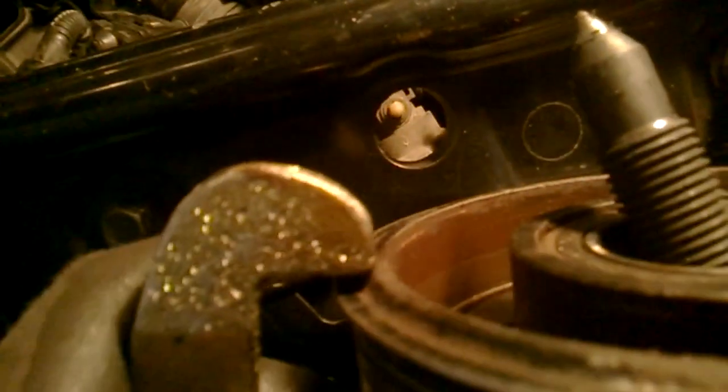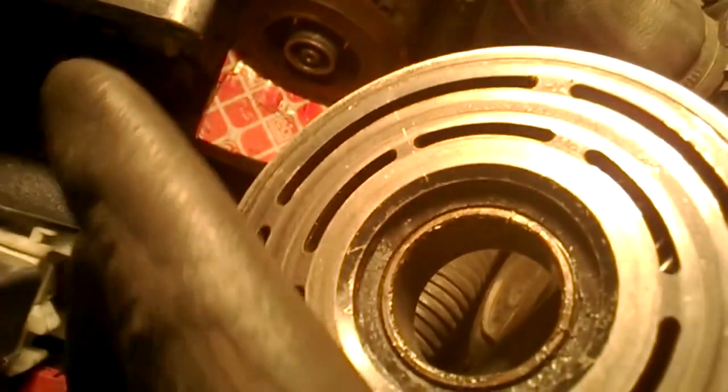On both sides, be careful not to go too far — you won't be able to anyway — because the pulley ends there on both sides. Compared to the clutch plate, the part that goes into the compressor is inside there. The pulley with the bearing is pretty stuck in there. I'm going to punch out this bearing and place a new one. This one was not so tight so I got it out.